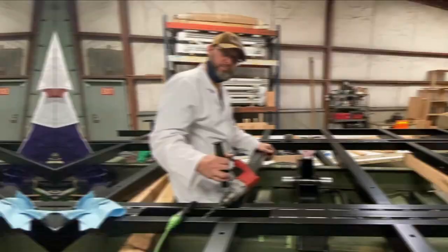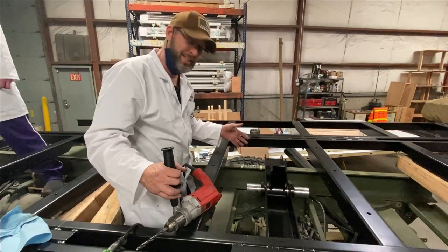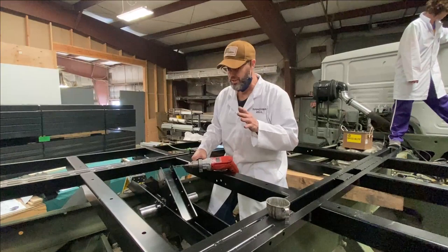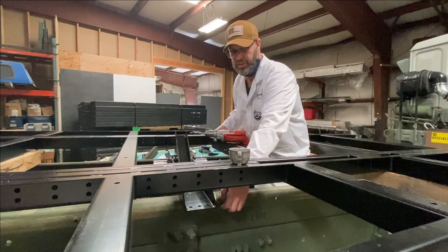After you're done drilling all the holes, install the bolts as shown. So this is a universal crossmember — you see it's a little bit wider than what I actually need, but the goal is it will accommodate 48-inch wide subframes, so you have an opportunity to use it for pretty much any vehicle. With every expedition there is an expectation of ruggedness and severe duty without ever losing or breaking or having any troubles in the field. So I'm going to use the long length of this to actually build a secondary gusset using these holes that connects it to the frame — that will prevent the loading on the bolts and actually allow the loading to be on the side of the frame, helping transfer forces and loads that we can't always predict.